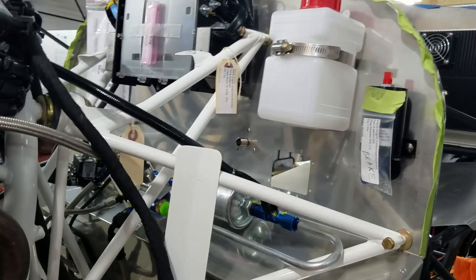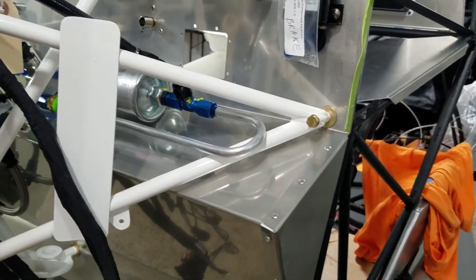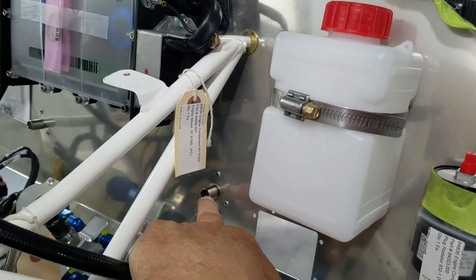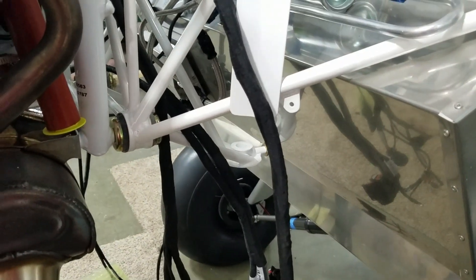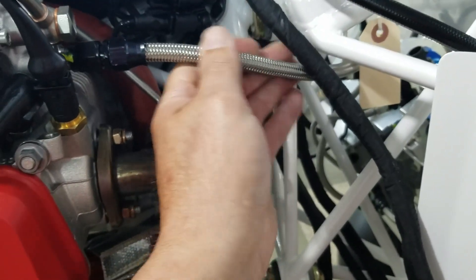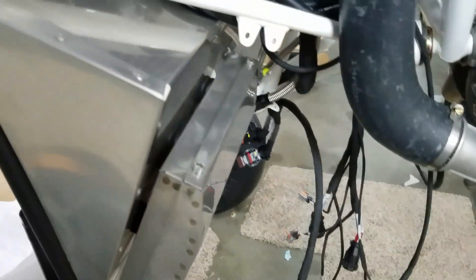The firewalls are pre-drilled. Parts just go out and there's no reaming. You do have to drill a few holes here and a few passage holes where the water goes through for your heater - those two passes you have to drill in. But the majority of stuff is pre-drilled. Holes line up, stick a rivet or a bolt, whatever is supposed to go in there, and it all fits. The hoses you have to make, but they're not hard. There's a website you go to that tells you how to make them. We've got the vacuum system with all the indicators - three of them - all mounted.